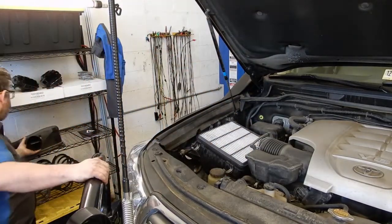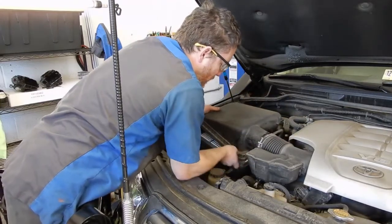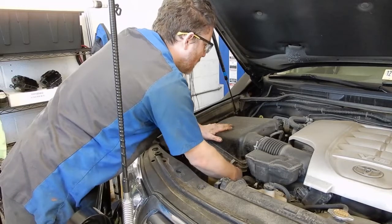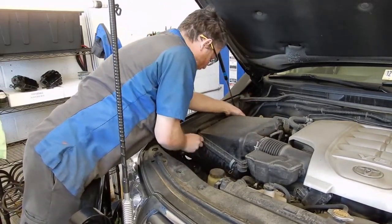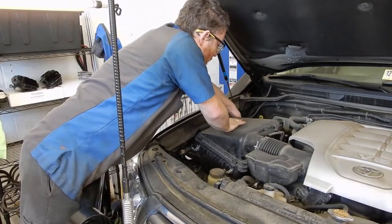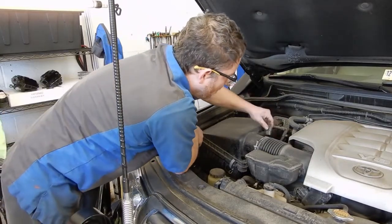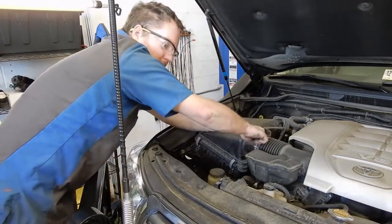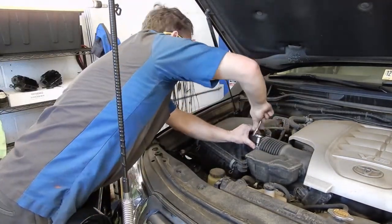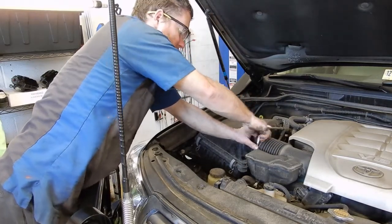There we go. In the top half of our housing. Helps if you don't latch it on the hooks in the back. We plug our mass airflow sensor back in, clip our wire, and just tighten this clamp up real quick. And we've got a snorkel.